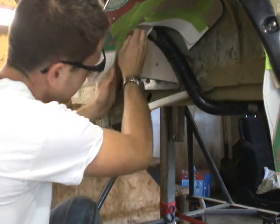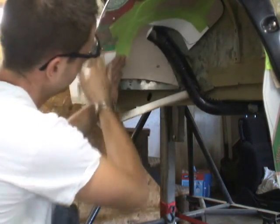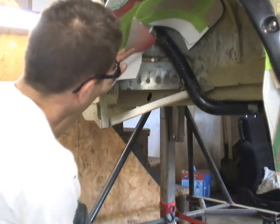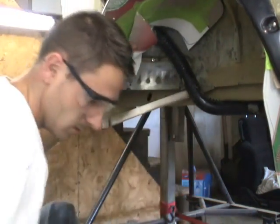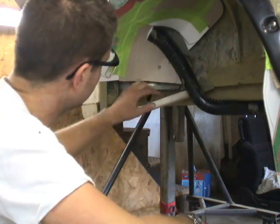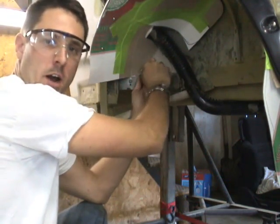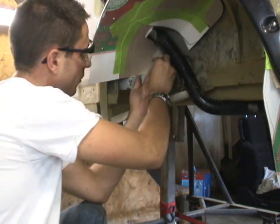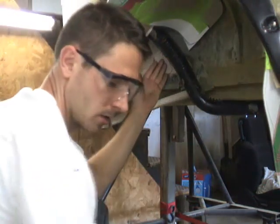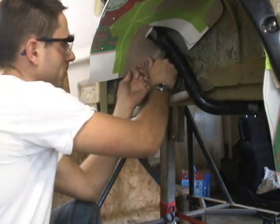Get everything in position — right now I'm just taping up my extra pieces. So now I know roughly the area this is going to be in. I've drilled my hole underneath and I'm going to push a nutsert into the hole. After you push in your nutsert, push the cardboard up into position and feel through the cardboard to see if you can feel that nutsert, then take a drill bit or some sharp object and drill your hole. Grab a fastener and mock it up in position.